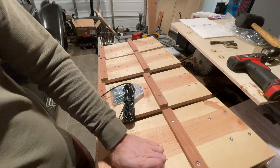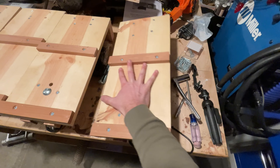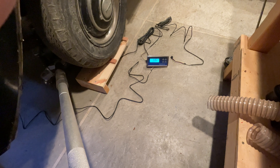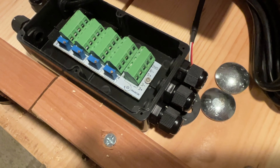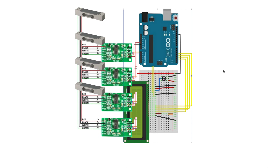I got about 80% of the way through this before I realized it was a stupid idea. For one, they're not very stable given their compact tripod design. Also, the wood platforms made some unsettling sounds as I loaded the car weight onto them. This made the whole situation kind of sketchy — and don't get me wrong, I like a certain amount of sketchy, but this was pushing it. Also, the tires really need to be in the exact spot, otherwise the leverage will be wrong and give you the wrong readings. The real nail in the coffin was that the readout needs to be calibrated separately for each load cell. The way I was doing it meant I would need to calibrate it to one corner, measure that corner, move to the next corner, recalibrate, measure, and so on. I started to draw up an Arduino design that would have four separate adjustable inputs for each load cell and a display to show each weight. At that point, I decided to just wipe the drawing board clean and start over.